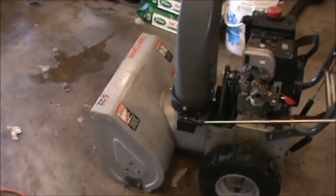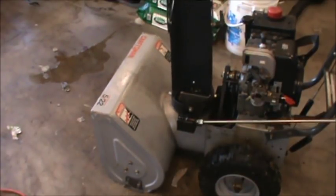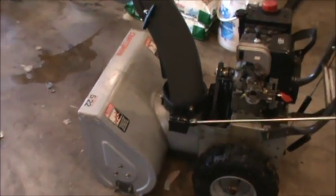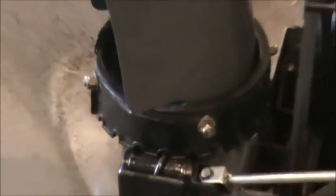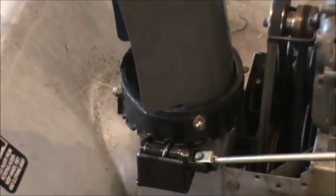Here's a look at the part back on the machine. I found out there's an inner ring that's plastic too — there was a crack on that as well that I fixed. This thing didn't spin at all, and now that I have it welded up it seems to be spinning great, working very well. A tip for you: if you have to do this for a pair, I think it's pretty common, and the parts — if I had to get those two rings — it would be close to 80 bucks. Don't tighten those bolts too tight. They're lock nuts, they don't have to be torqued down. Whoever put it on there over-tightened those bolts and that's why it ended up cracking.